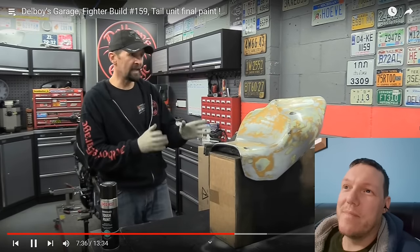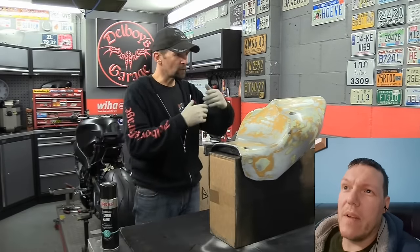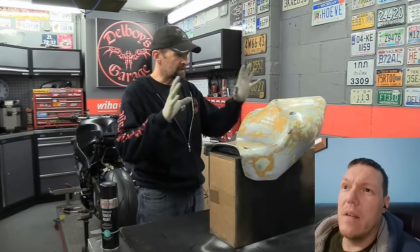Grease now. I'm going to leave it for about another half an hour, just for all the vapours of that acetone to just evaporate away. I'll come at it. We'll do a first tack coat.